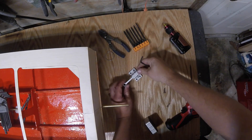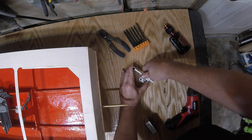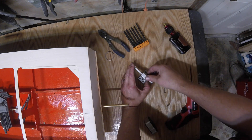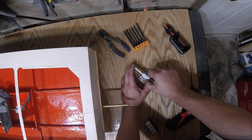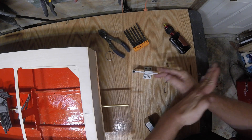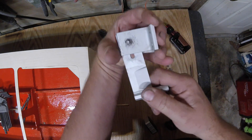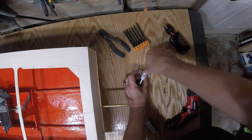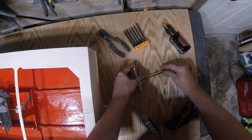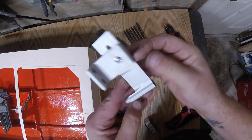What I'm going to do is push this all the way up. Joe at Zipkits does give you directions on where he recommends you put this — I just do it my own way. Put this on a perfectly flat surface and you'll see how the bracket lines up with the strut bar — nice and flush. I make this all the way up, as high as that strut will go. I make sure this is all nice and flush, which is why you want to go to your kitchen counter or wherever you can find a nice flat surface. Then we're going to torque this down so they're nice and even.